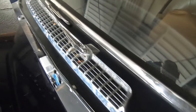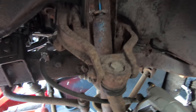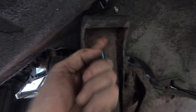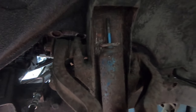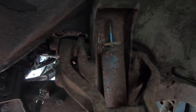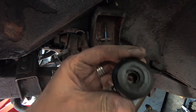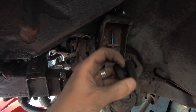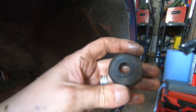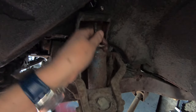That's how the wipers and their parking mechanism work on a P5 and P5B. Moving on — I've had some success removing the front damper. I've taken the top nut off from the damper tower and also removed the bottom bolt, which wasn't too rusty and came off okay. The top bush actually seems to be in surprisingly good condition — it's not perished — so someone may have already replaced the top bushes.